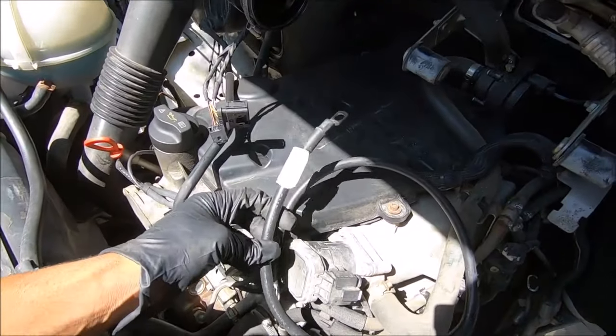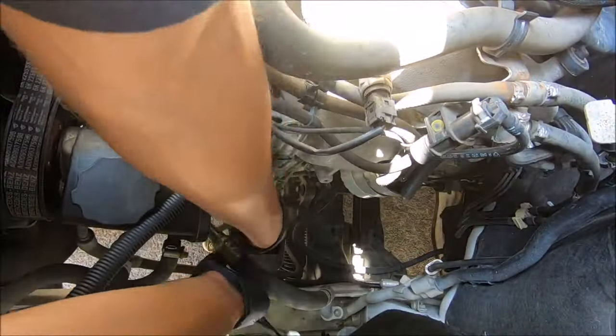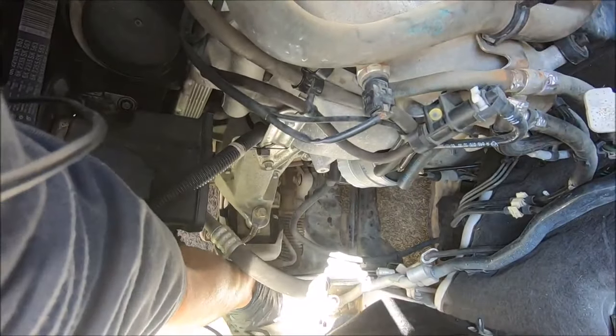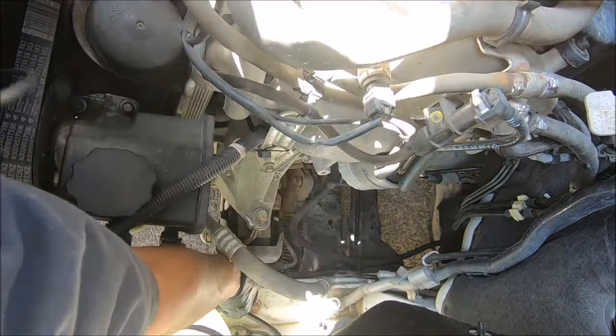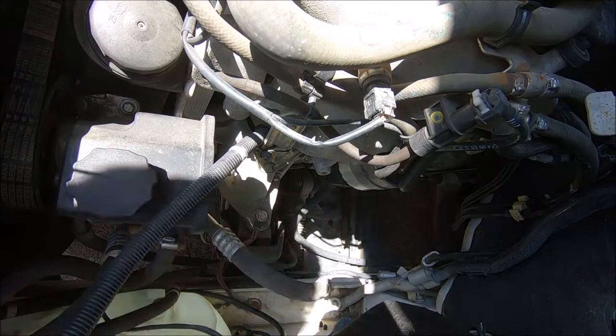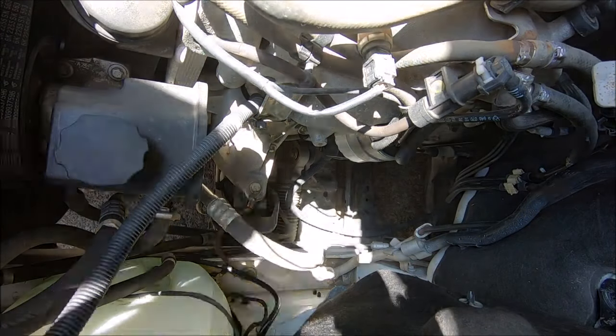This is my new ground cable I'm going to be running in addition to the factory existing one. I ran the new cable from the intake manifold bracket. I removed one of the bolts there, and I ran the cable up to the top where Mercedes-Benz supplies the factory grounding point, where you can connect up a charger, or how you jump your vehicle if it's dead.